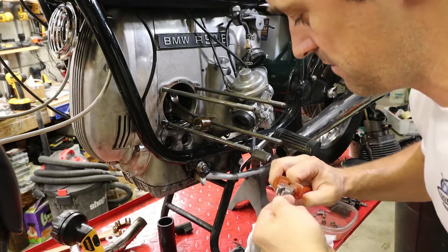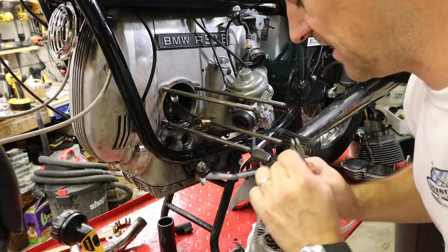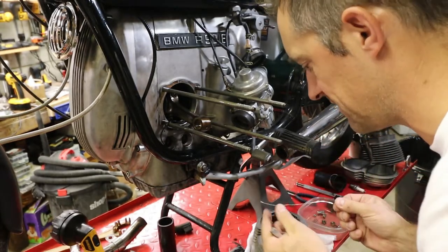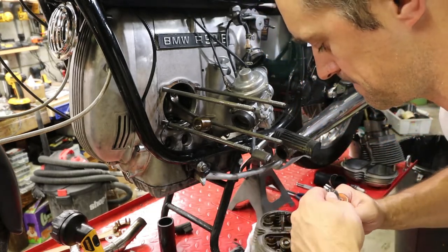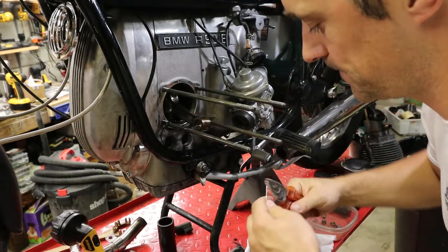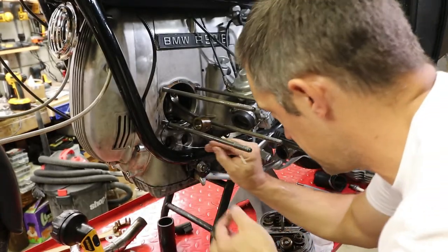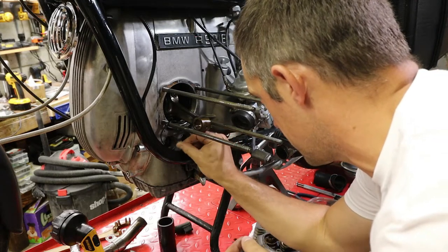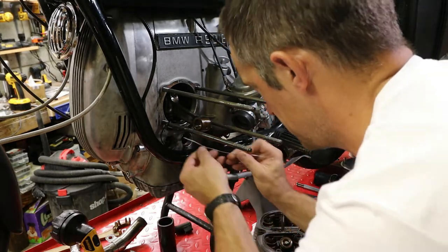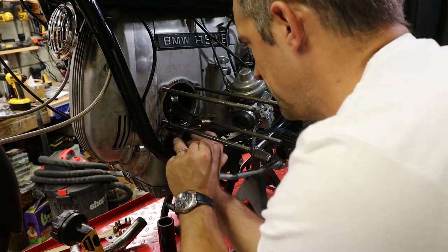You might be able to pull it out without a magnet because you don't wanna accidentally magnetize the lifter. And then you're totally attracting metal shavings and such. Let's see if we can make this happen. Just a little hook at the end. And then you stick it in and then it wedges. At least we hope. There you go. You don't want to mix those up either.